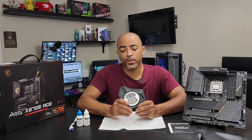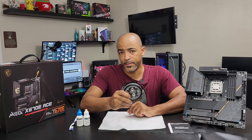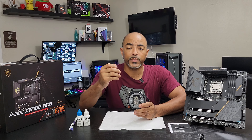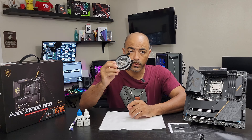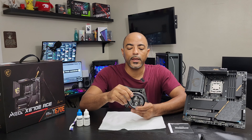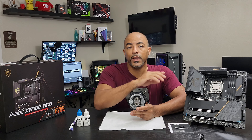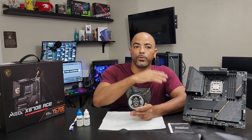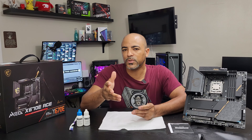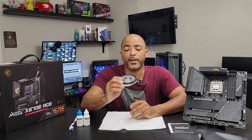It's not as clear cut and dry as AMD said. You actually may have to get special parts from water cooling manufacturers, AIO manufacturers, and air cooling manufacturers in order to have your old cooling solutions fit on these new X670E motherboards or whatever type of new AM5 platform motherboard you get, because they are not all compatible.